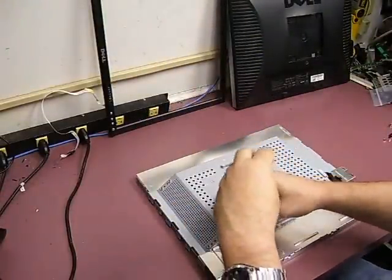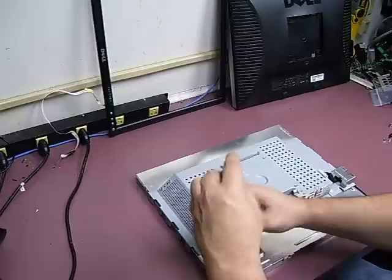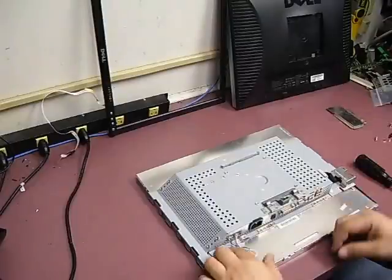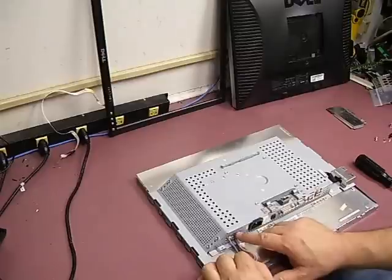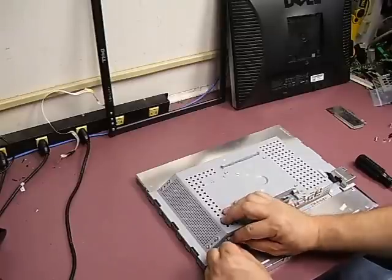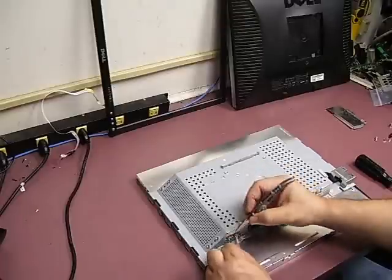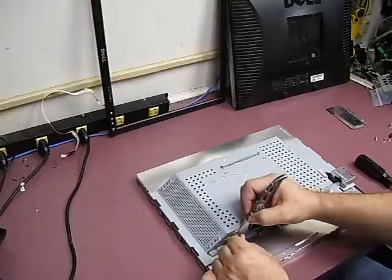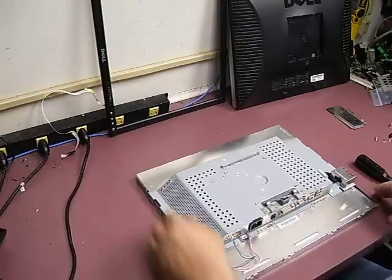There's a metal shield cover held in place with two more Phillips screws — remove that cover. Now you'll see two of the backlight cables. Where they plug into the board there are little squeeze-to-release catches. If you have enough of a fingernail to depress the catch you can do that; if not, use a small screwdriver or pocket knife and depress the top down as you're sliding the connector out. Don't just pull on the cables — the cables will pull out of the sockets and ruin the backlight.